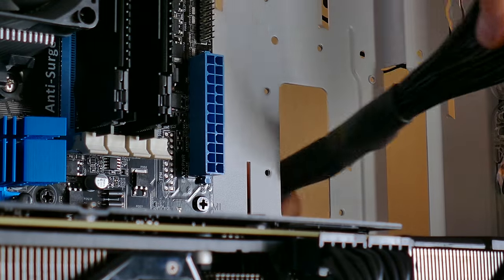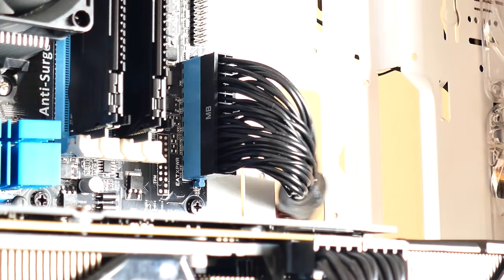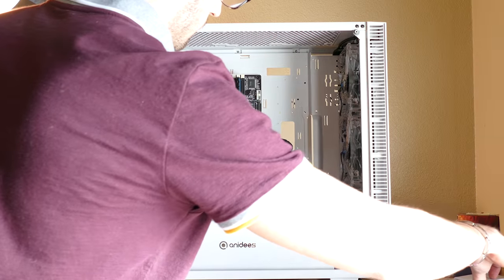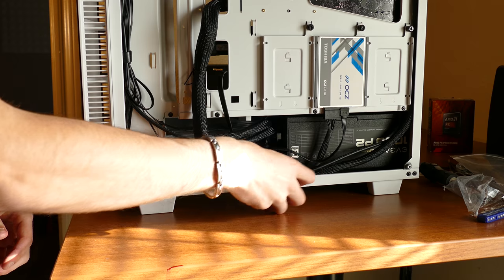Do the same for the 8-pin CPU cable — we'll only need one half of this for this particular board. It isn't the greatest overclocker, but at $15 I'm not complaining. Funnel the 24-pin cable through as well and connect it to the large header on the board — wait for the click; that's how you'll know when it's properly secured. With that, turn the case back around and cable manage as best you can. Take the time to verify that no peripheral is left unplugged. I almost forgot the Molex fan hub connector.